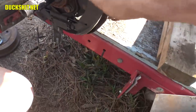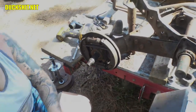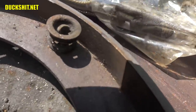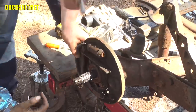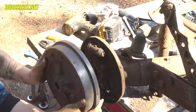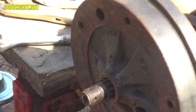I discovered I was missing the pins, spring, and clips that retained the brake shoes in place — these are important, don't leave these out. You can't use the pins from the later shoes as they are too long. I suppose you could modify them, but I just ordered another set. This is where you would install the e-brake cable, but I was forced to leave the shoes out for the moment as the new pins didn't arrive in time for the video. Just for demonstration purposes, the shoes were left out and the drum was reinstalled after greasing up the axle splines. This is important, or you could end up with a stuck drum the next time you have to remove it to do some brake work.